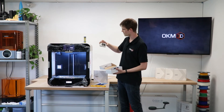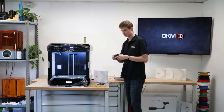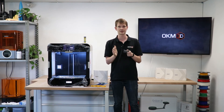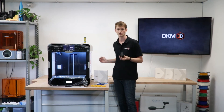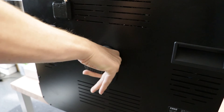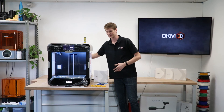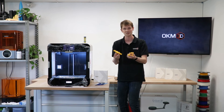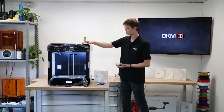There's also a USB stick with the slicing software and the spool holder. The spool holder is extendable — it can get longer for bigger spools or collapse for smaller spools. It has an oval fitting at the back that slots into the oval hole at the back of the printer; you rotate it 90 degrees and it's fixed. I recommend keeping all the transportation safeties so that if you ever need to move or ship the printer, you have them to make sure nothing breaks.